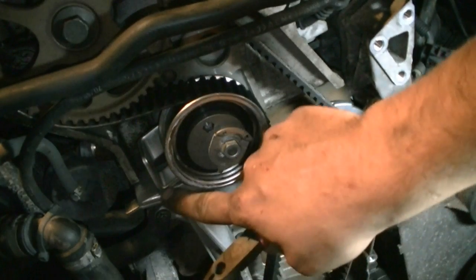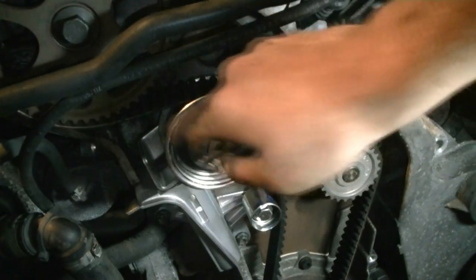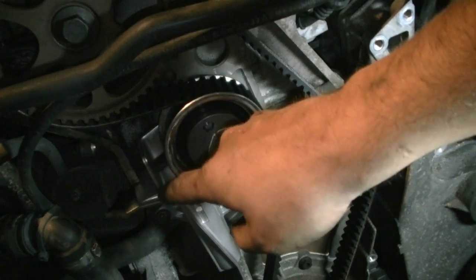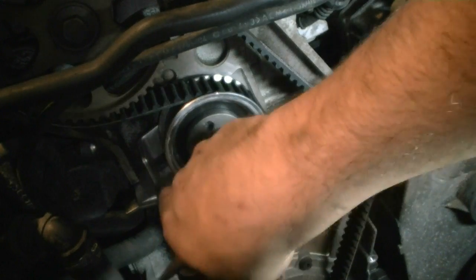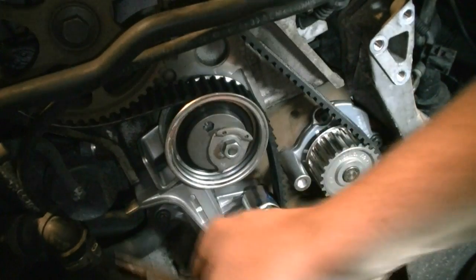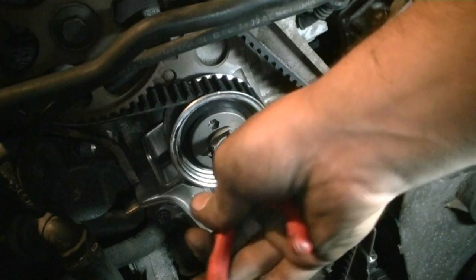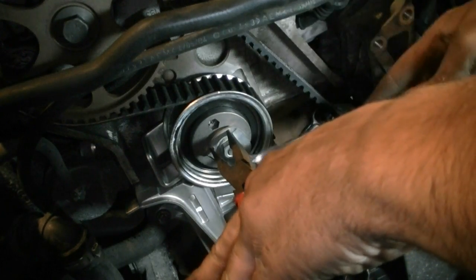The space you need to maintain between the piston and this part of the tensioner roller is 6 to 10 millimeters, and we're going to measure that by using drill bits. Get an 8mm drill bit and see if it can squeeze in there, and then you're good. But before we do that, before we take this tab out of the piston, we're going to get this to roughly this area and tighten this bolt right here.